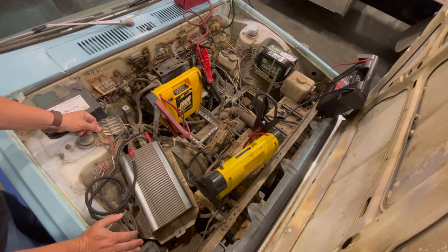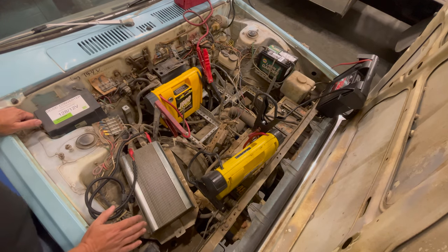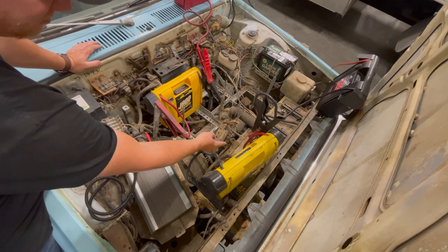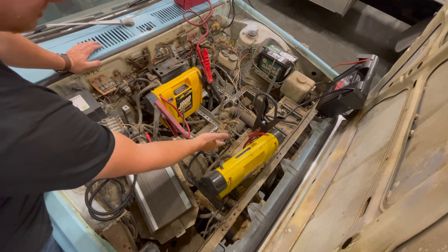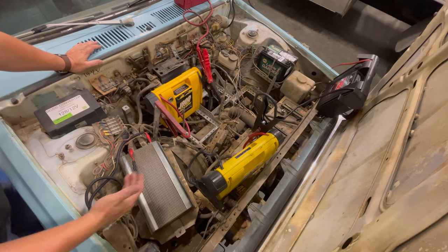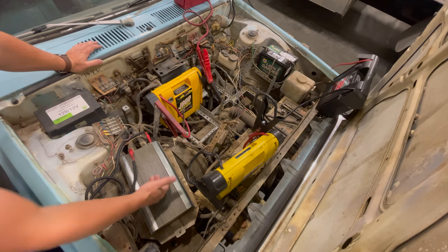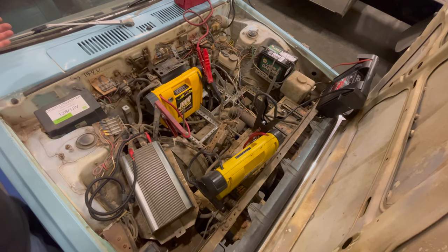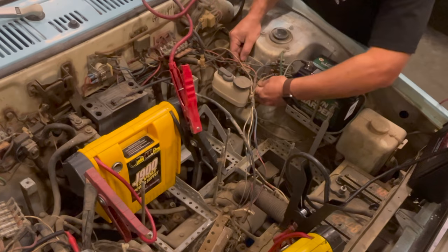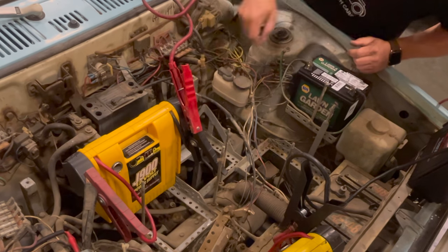This time I've looped in two more batteries — one is the jump pack I had connected over there, and my tow truck is right next to this car, so I tied in the tow truck's batteries as well. Now we're up to 70-75 volts. I'm going to try manually turning on the motor controller again — it probably wants voltage from the battery direct, so I can power that off of this terminal right here, which is our battery positive. The car is still in neutral. We can actually see our vacuum pump now — it was located down there under the third battery.